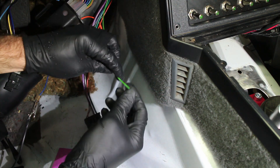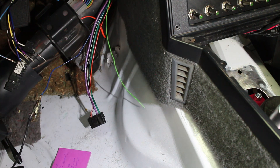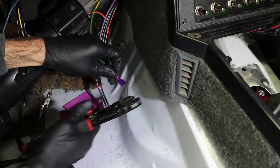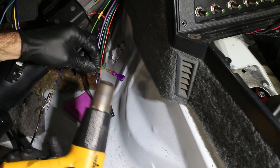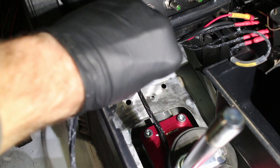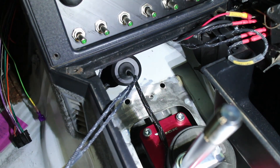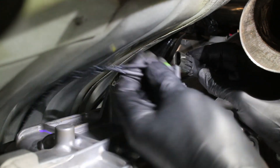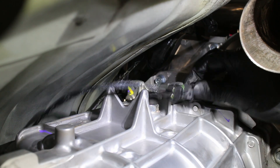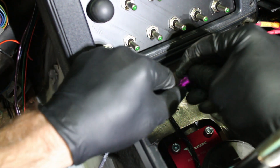So the reverse light is next. It's located in the old automatic shifter plug as a tiny green wire. I crimped a terminal to the green wire. The reverse wiring is very easy — you just need to provide 12V to the green wire and the reverse lights will turn on. I used this old hole where the 700R4 shift linkage used to be. The T56 Magnum reverse plug is a 2-pin weather pack. You can buy these plugs as pigtails for not that much money. One of the two wires connects to the green wire and the other one to a 12V source. Put the T56 in reverse and the backup lights work.